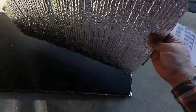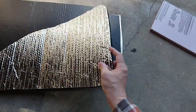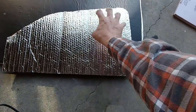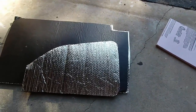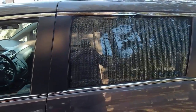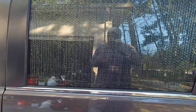And that's all it is — it's very, very lightweight. I cut the felt slightly bigger than the Reflectix so that I can tamp it into the window, and they stay up rather well. These panels are fully reversible, and when I'm out in the sun I put the Reflectix layer facing out. That does a really good job of reflecting heat back.